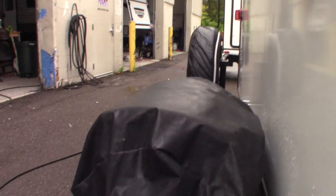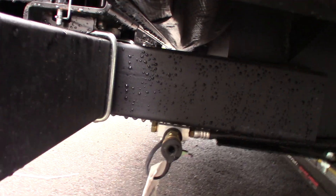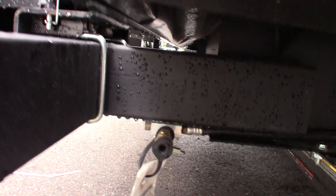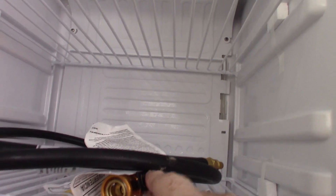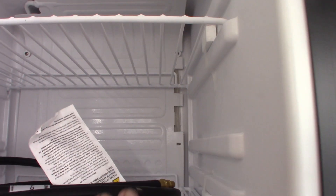There's a grill underneath here, and you have to plug the grill into this quick-connect LP fitting here. One end of the LP hose goes to the back of the grill, and the other end goes to that fitting under the trailer. Here's the hose itself — it has a quick connect and a male end on it.